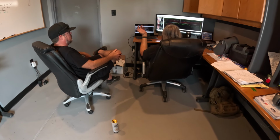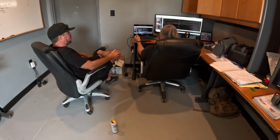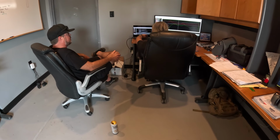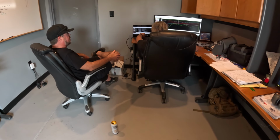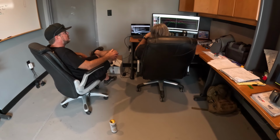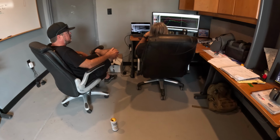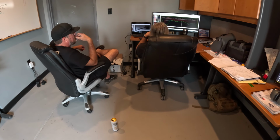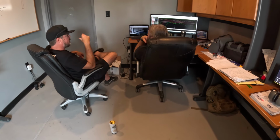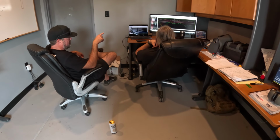Actually, I should be able to scale these the same. Let's do that. Okay, 8,000. There you go. That looks like a clear clutch slip and grab, to me. Yeah, and when it does that, look what it does to the boost.